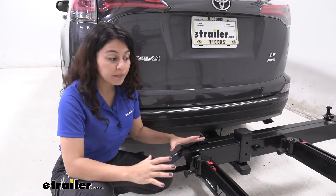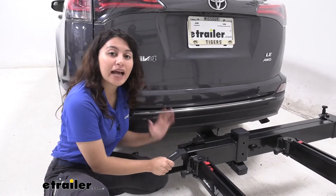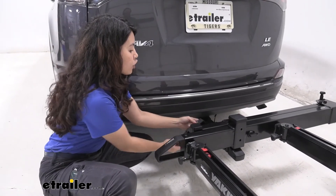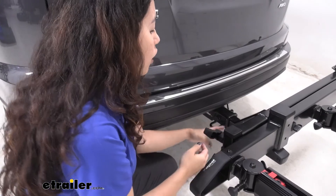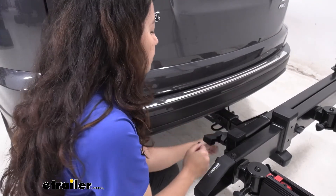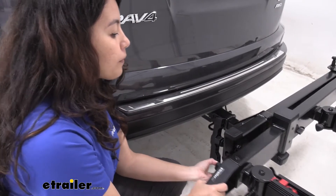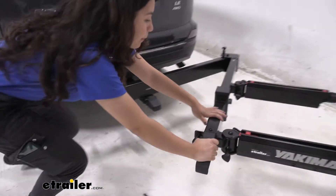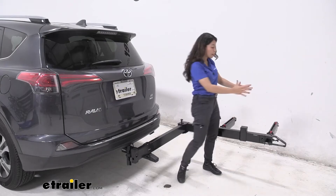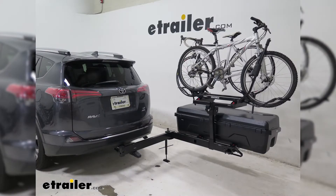The main feature of the swing base is that it can swing away. There's a handle on the side — please use this as you swing it away and bring it back, as this is where you'll get the most support. To start the swing-away process, loosen the knob at the back. On larger vehicles with protruding bumpers this can be a tight fit, but there should be just enough space to rotate that knob. Once loosened, pull out the other knob to release the entire swing base and push it out 90 degrees until it secures in the corner. This is especially useful with the bike rack, where you can mount and dismount bikes on each side.